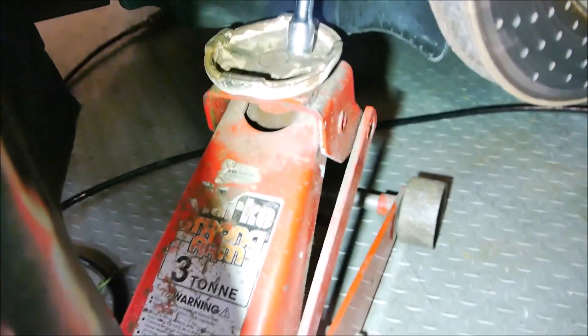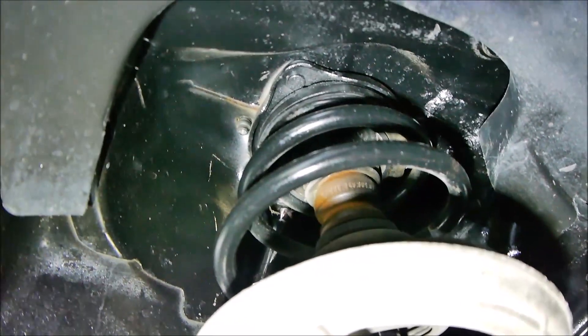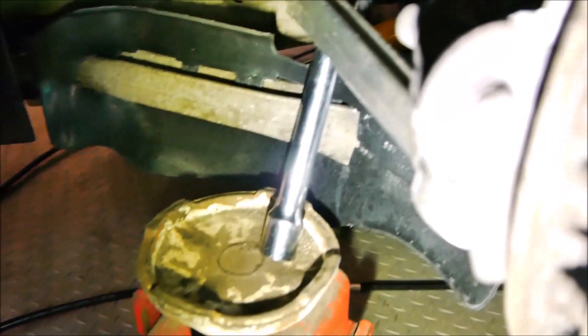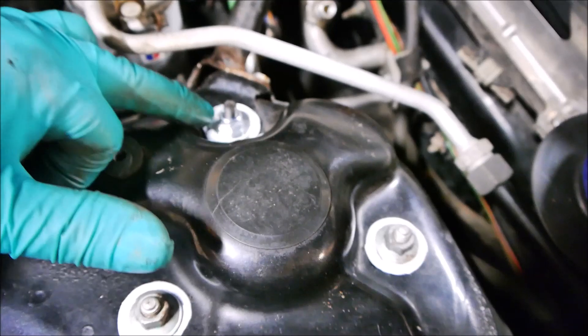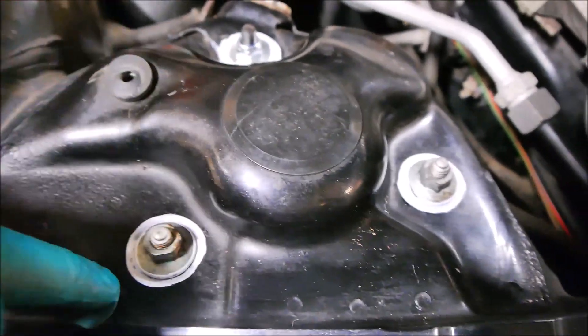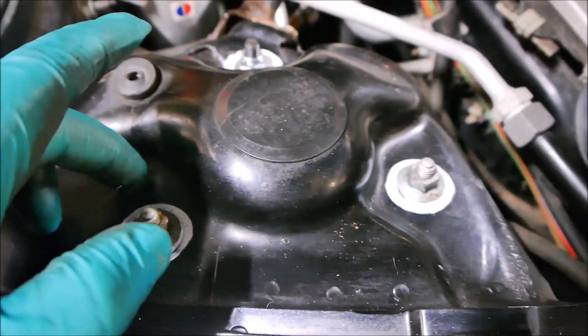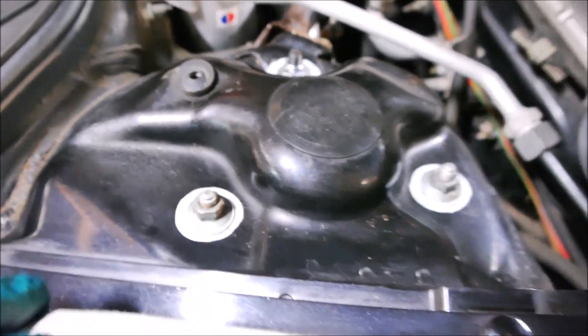Look at this for junkiness! I've got the jack, a 12-inch extension, a 6-inch extension, another 12-inch extension, and then a socket right on the base of the cup - and that's taking all the shock load down there, holding it firm so I could press that stud out. So, repair done - a bolt in there, an allen head bolt with a washer underneath so I can get the allen key underneath and tighten it on the top. I've now got three bolts. I'll circle these because that's where it's set for the four-wheel alignment. When I eventually take this strut out I'll replace the front struts and put a proper splined stud back in, but this is as good as a stud - it's a nut and bolt all the way through.